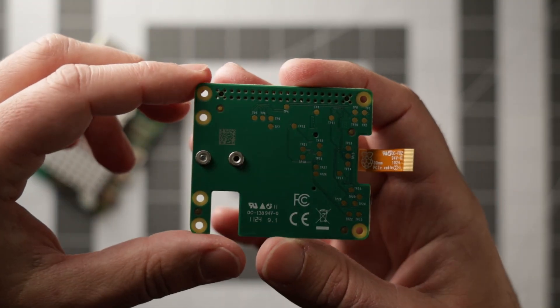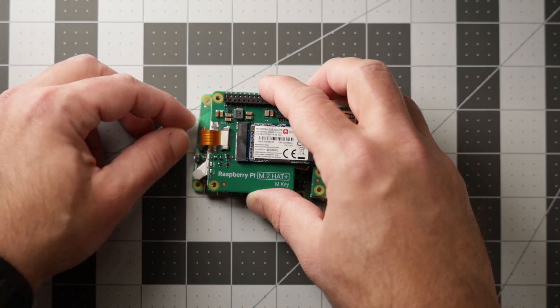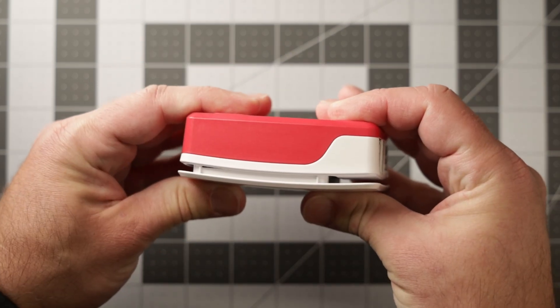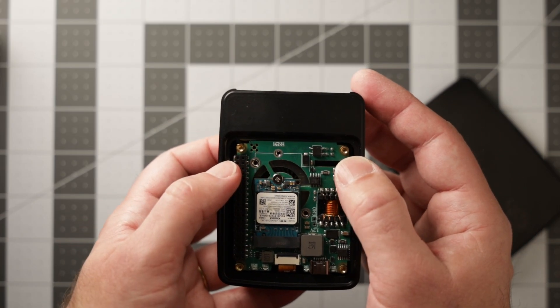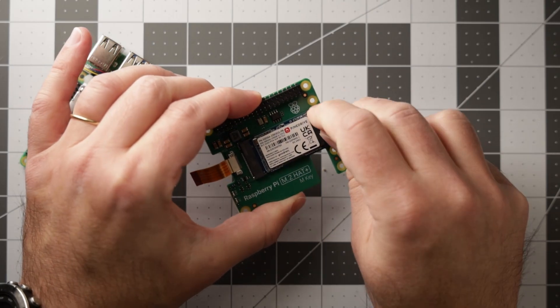The official Raspberry Pi M.2 hat is as standard as it gets. It's not something to write home about, but it's pretty affordable at only $14 and is available from pretty much all Raspberry Pi retailers. It only accepts 2230 and 2242 SSDs, which is fine considering it sort of fits inside the official Raspberry Pi case — though you can't really put the lid on. Some of the other hats, like one from Hacker Gadgets, have cutouts on the edge of the board so the lid can snap around the hat. I appreciate that Raspberry Pi included a tool-less thumb screw to secure the SSD to the board, making it really easy to assemble from the top. Some boards make you screw the drive from the bottom, which is a pain since you have to remove the hat to change drives. So extra points for easy drive swaps on this board.